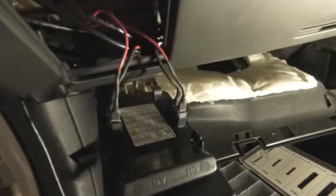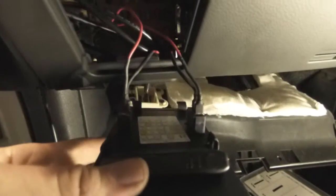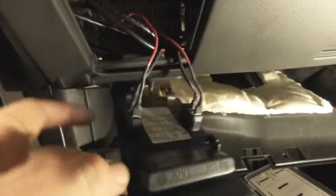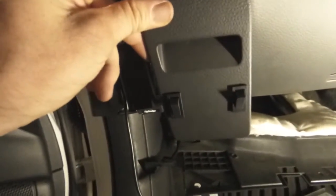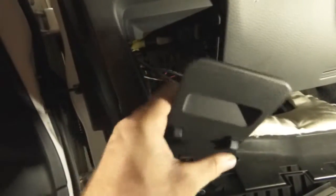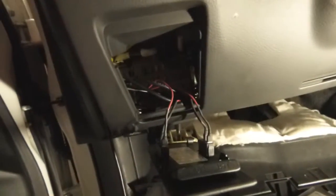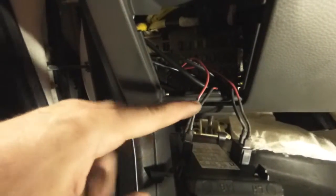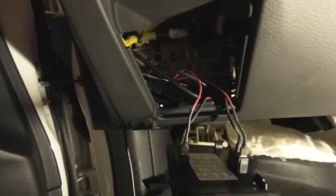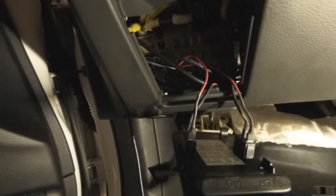I came out on top on this one — I didn't have to destroy anything, so I'll still be able to check where my fuses are. Looks really good, I didn't scratch the front of it. I was able to use my Dremel — they're pretty sweet. Got them both lined up. I didn't change the wire colors this time, I just made a braid. I'll do a continuity check to double-check which wire I'm using for what — that'll let me trace the wire back to the front of the vehicle, and I'll do left and right for the fan.